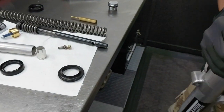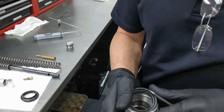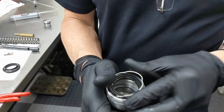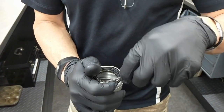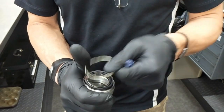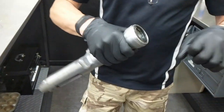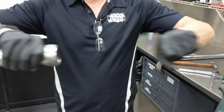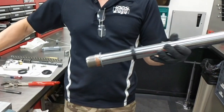When you look down into the tube, you're going to see your fork seal in there. On that seal is a wire spring clip. Same thing — it's very easy to extract. You just take a screwdriver, pry it, and that spring will pop up right around the chrome tube. Once the clip is out, you just take the two halves of the fork and bang them apart — slide hammer them apart from each other. Bang, bang, bang — it'll come apart.